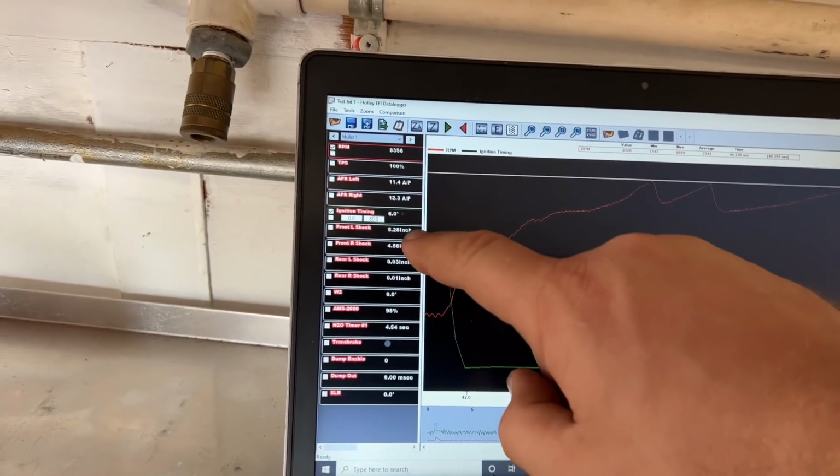With the downforce, the front end is down an inch, so we're going to work at the suspension. I messed up a little bit with the starting line retard. I had done something to show you guys the video before and forgot to swap it back, so it actually had no starting line retard in it. It had half a degree for 0.4 of a second, maybe, if that. So nothing really spectacular there.